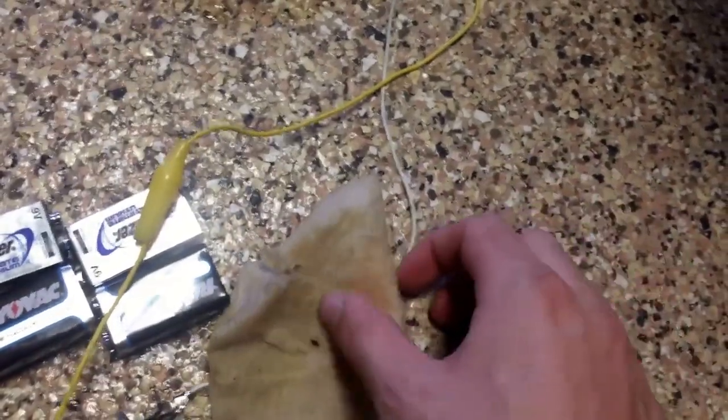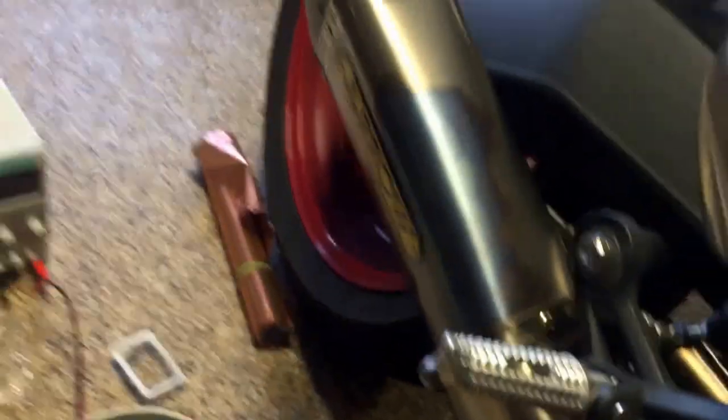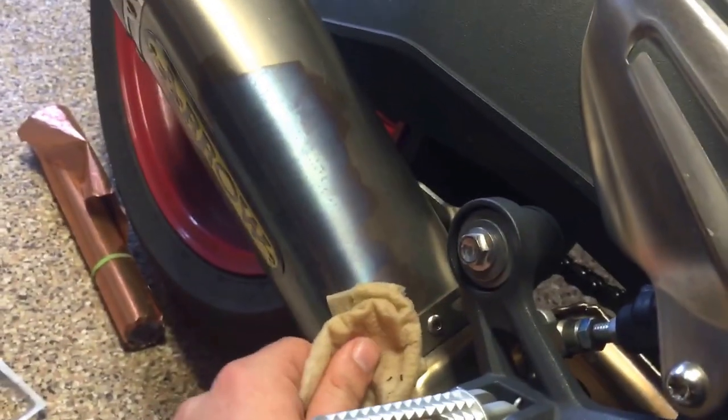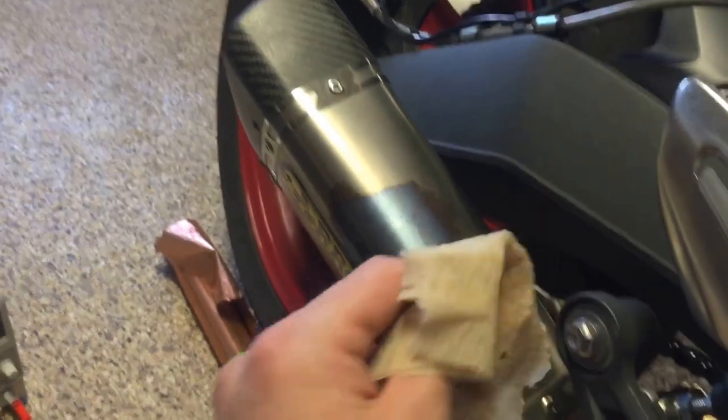What you want to do is wrap the piece of foil in a piece of paper towel that's been dipped in the soda — just one layer if you can help it between the piece of foil and your exhaust. Sometimes you need two layers because it's shorting through the paper, and that's fine. The least amount of layers, the quicker the exhaust will turn blue as a general rule. Be very careful that your finger does not touch both terminals at the same time, because that will electrocute you and it can be fatal. It doesn't take that much current to kill a person, especially at 36 volts.